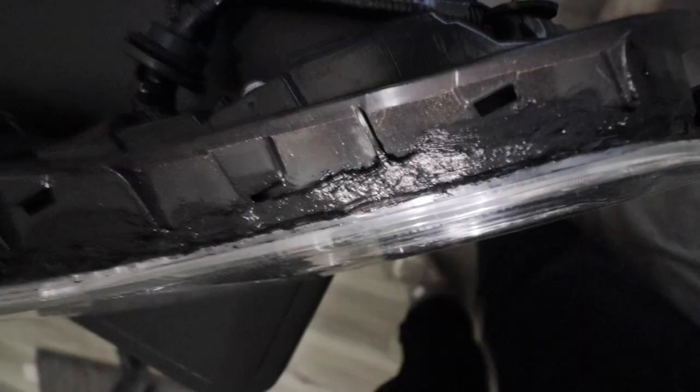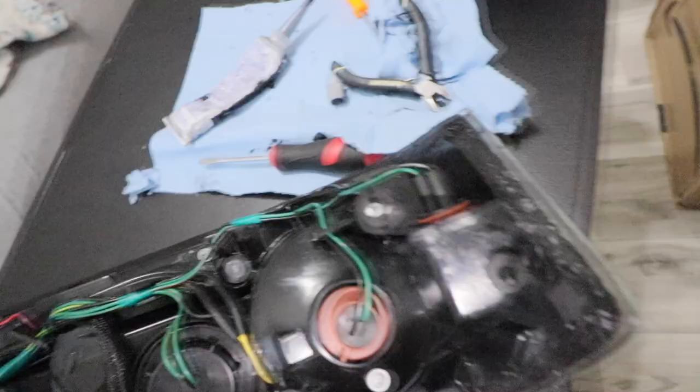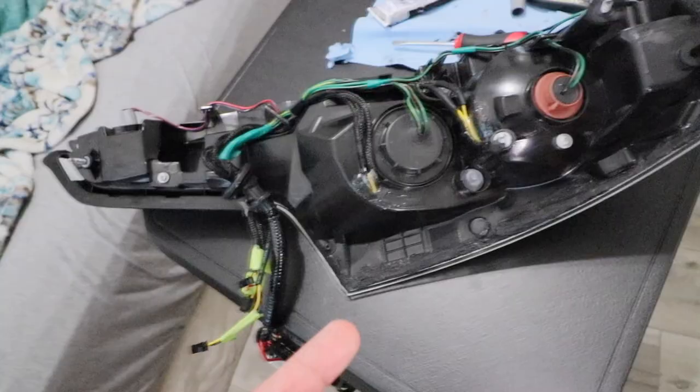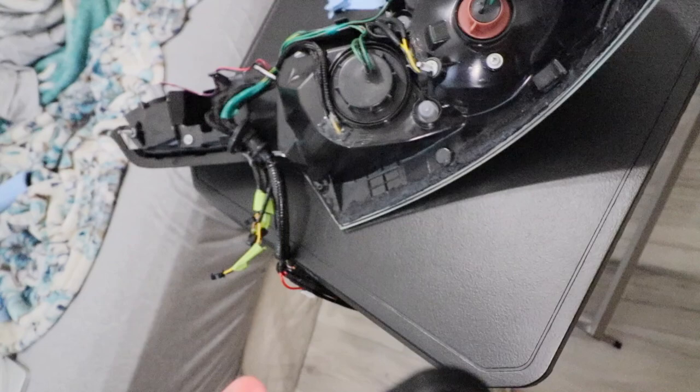We pretty much added silicone all over. This is the one that wasn't fogging, but I still put some on just in case — a double seal, just for peace of mind. At this point it's really just cross your fingers and hope you sealed all the holes. If you seal it, put it back outside, and it's still experiencing condensation, there's still an open hole somewhere that you probably cannot see. You can try to reseal it and find the hole, or just buy a new taillight or crack it open and reseal from scratch.